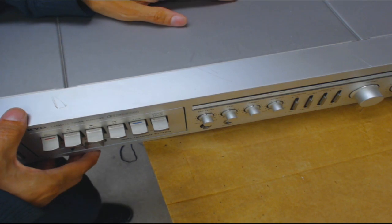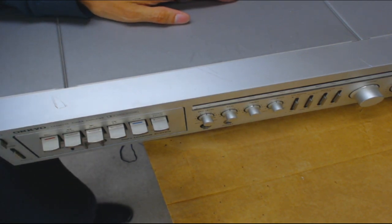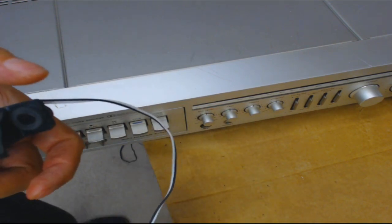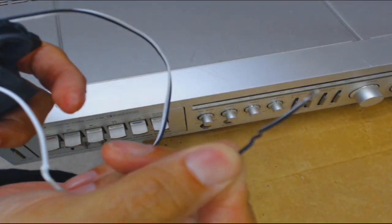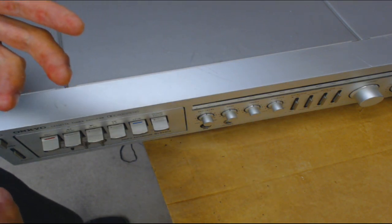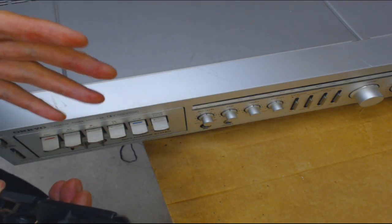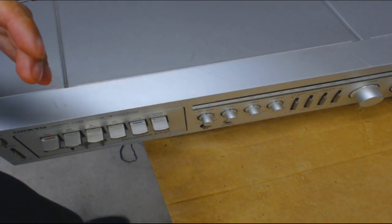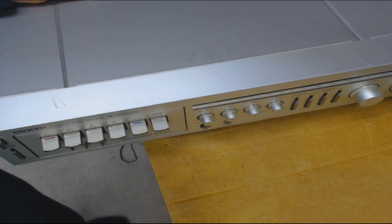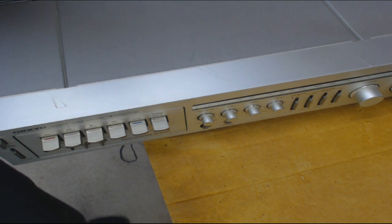The back has, let's see, RCA jacks for 2 speakers, and it has what I would call straight through connectors. You literally just take straight speaker wire and connect it, not RCA or anything else. 4 of those, positive and negative, so 2 speakers, 2 RCA, 2 straight through speaker wire connectors. It also has a built-in antenna. It has an external antenna connector for AM and FM, and I think 2 different FM external connectors, one 75 ohms and the other 300 ohms, and then just a standard AM antenna, which I have one.